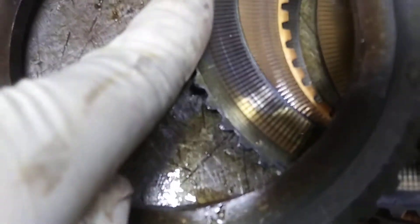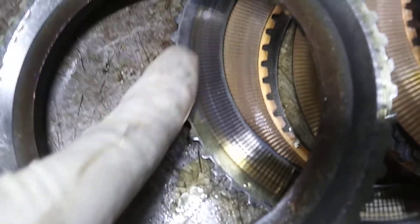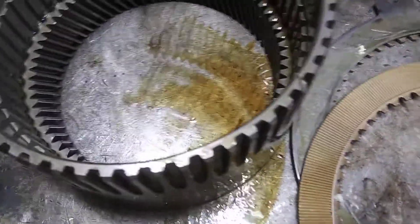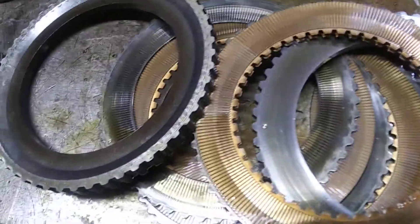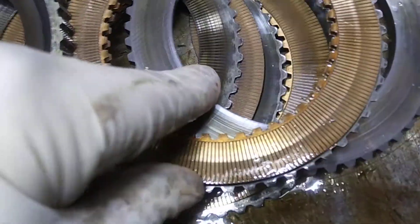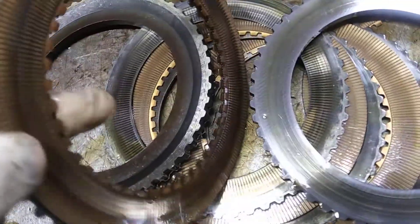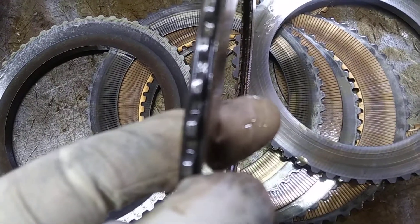We have gluing of the steel plates in forward, coming out of this drum. Of course, just for those of you that are new to our channel, please subscribe and click the like button if you would — that way we move up on the food chain here with YouTube. What we have here is it was just getting to the point where the clutches were starting to fuse to the steel plate.